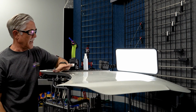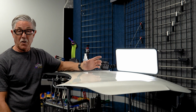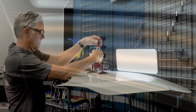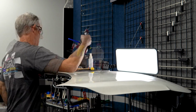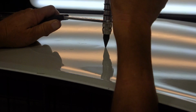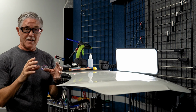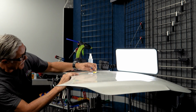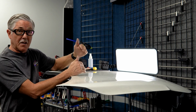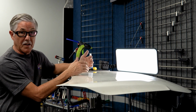Okay, so obviously glue pulling is a process of elimination. You're not going to get it out in 1 or 2 or even 3 pulls on especially almost a 3-inch dent. I'm going to tap that down a little bit more. If you're trying to fix dents with glue tabs only, the success is going to be dependent sheerly on how you knock down, right? So if you knock down on the highs properly from highest to low and you don't get into the low areas, it's going to work out so much better for you. Otherwise you're going to have to make multiple pulls and you'll be chasing it.